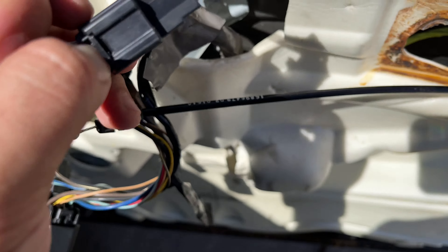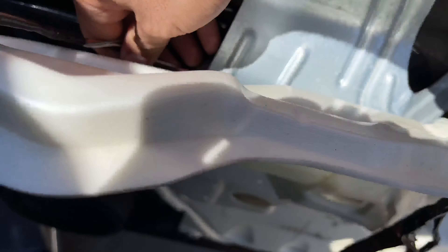Now we can follow the wire from the mirror down to where it's connected — right here. We're going to go ahead and unplug this. The way you do that is push that little tab in and pull the connector up. Pull the other wire — just like that. Remember how it's routed: it comes in through here and goes on through there — it comes out through there.